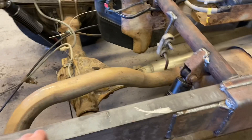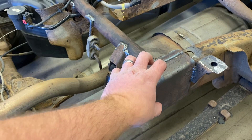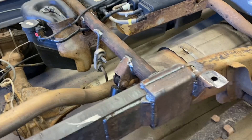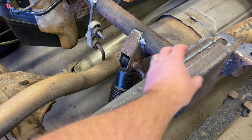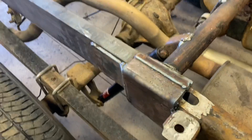This section of the frame is bent — it's got a curve in it from the factory. What we did was bend this piece up to cap the existing frame. It was kind of rusty back here, but I didn't want to cut any more off because I needed a level guide to get started from. We were able to weld back onto the frame where it was more solid, welded it underneath and on the inside. This frame section sits in just a little bit more narrow than the original, and instead of having that bend it's just got a little offset in it now. This whole section is boxed in right here.